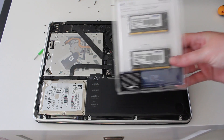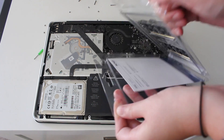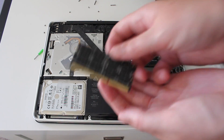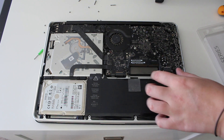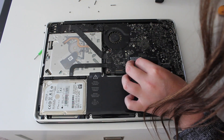I've purchased the Patriot Mac series of RAM — I'll leave a link in the description for Amazon. This brand works quite well; it's the one I used for my previous 8GB upgrade from the original 4GB that came in the machine. I check the gold connector plates to make sure nothing is on them, because last time I installed some RAM there was a tiny speck of glue and it messed up the whole process.